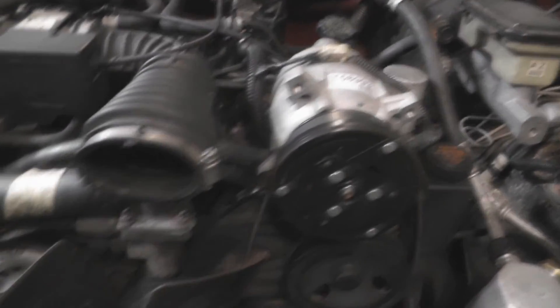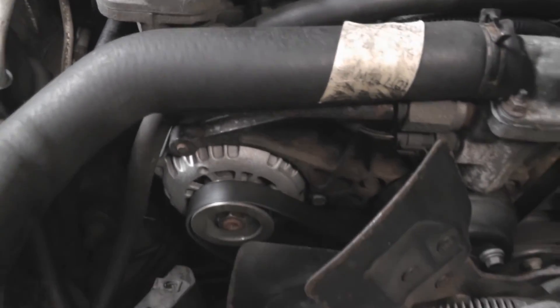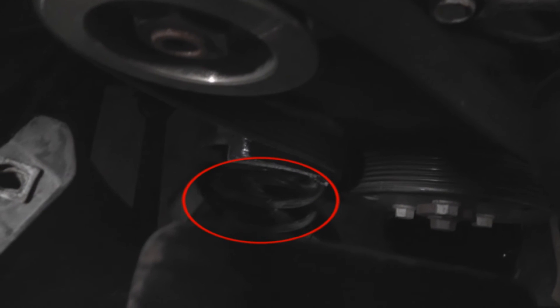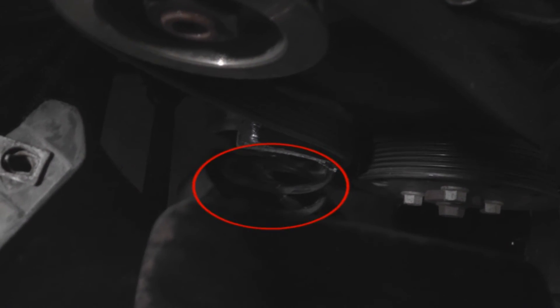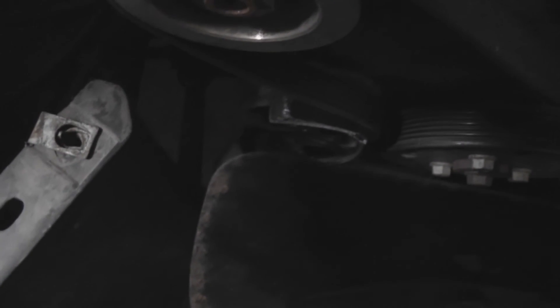This is kind of scary. I wanted to keep the AC compressor and the alternator, so I had to take off the belt tensioner. Apparently — and I didn't know this — there's a big spring behind it. I took off the nut and tried to pull it out, and that huge spring just sprang right out. I'm really glad my hand wasn't in the way, or that could have been a pretty nice injury right there.